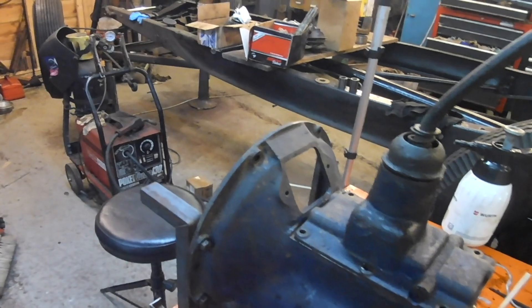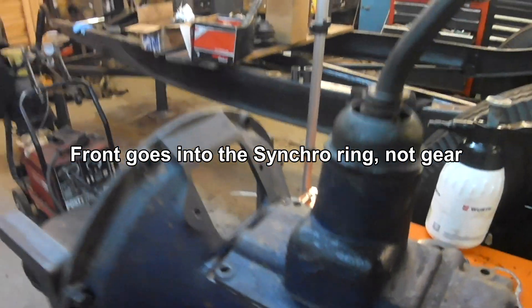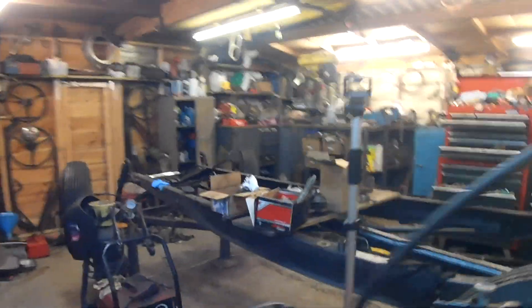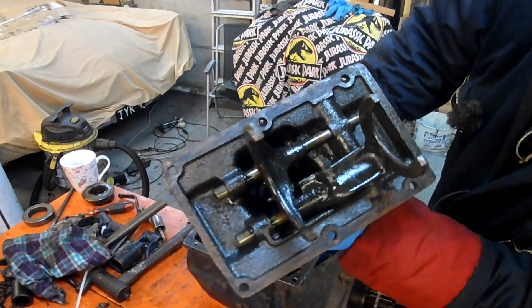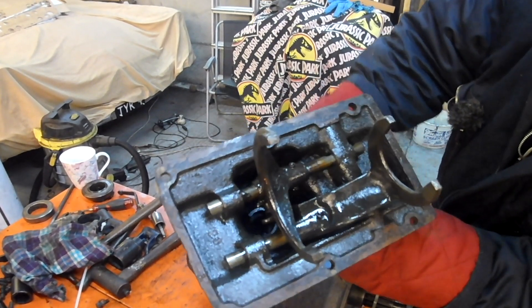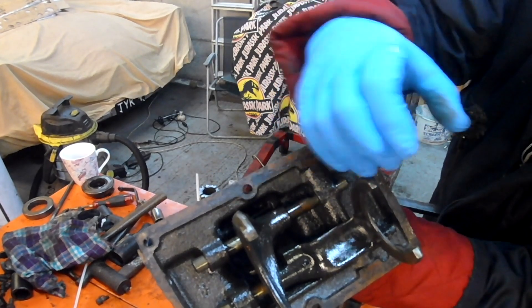Inside there there's two selectors. This one at the front goes into that gear there and the one at the back goes into the other gear. When you move the stick to this side it moves the small one. When you move the stick to that side it moves the big one. So here's underneath and there's the stick — when it's on this side it's engaged in the small one. When it's on that side it's engaged in the big one, so you move it backwards and forwards and these things move back and forwards.